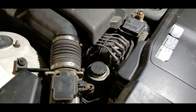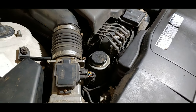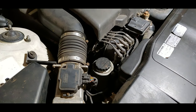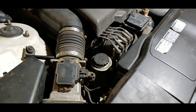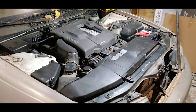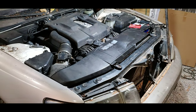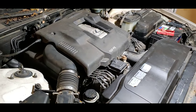What happens over time is that power steering will leak directly onto that alternator and short it out. I've even heard of guys having random shorts where the car will charge for a minute and then stop. So the big thing right now is I'm going to take all these pieces of plastic off — you've got to love Lexus. I'm going to show you what goes where and how to take it off, and then we're going to start taking that alternator off.